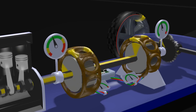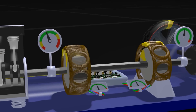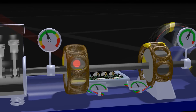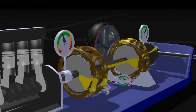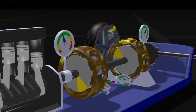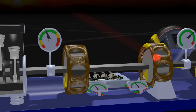Now you'd think that it stops there, but no. Motor and generator now switch their function. The motor becomes a generator, converting force to electricity, then feeds it back to the original generator, which is now a motor. Now the axle gets speed from the engine and from the electric motor, so the engine can work at a lower speed — it's like a river flowing upstream. So motors are generators and generators are motors. That's why Toyota calls them motor generators: MG1 at the engine side, MG2 on the other side.